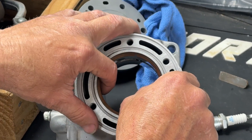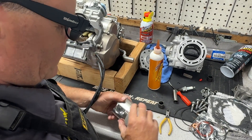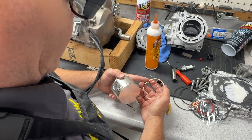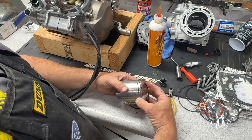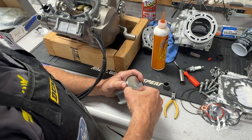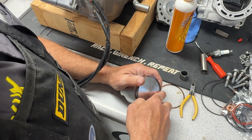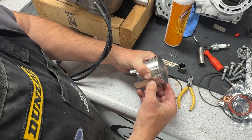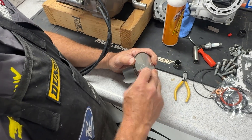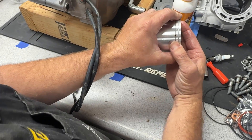Most bikes nowadays you'll never have to worry about the ring gap. I like to put a little bit of assembly lube in the ring grooves so there's some lube behind the rings on startup. If there's a letter on the ring, like an 'N,' that's the side that goes up — if the writing goes up, you're fine. I do the bottom ring first and walk it on, stopping at the ring pin. Those ring pins keep the ring from turning. The top ring is just a tiny bit easier.